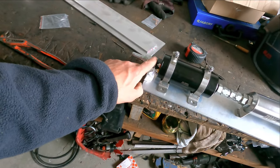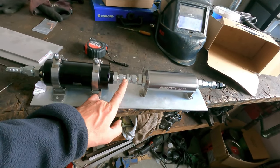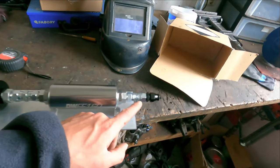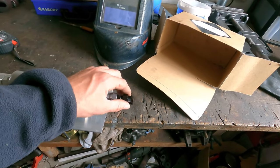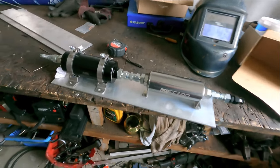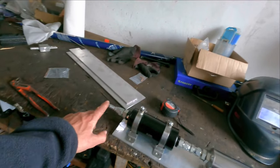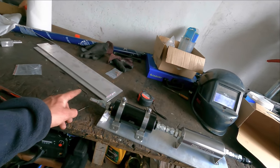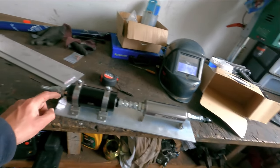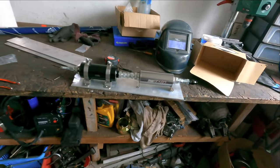I think these are AN10 connections, the filter also. In here it will go to a half inch, which I think is the same as AN8. That is how the rest of the fuel system will be. I will use flexible rubber lines to the tank, and from there it will be a hard line. In the front of the car it will be pressed Teflon lines.